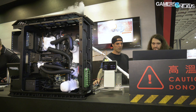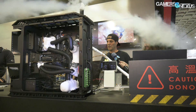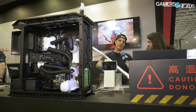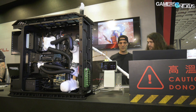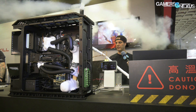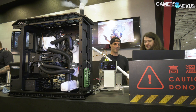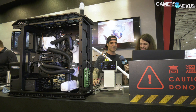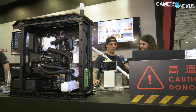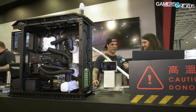It crashed — didn't make it. We passed on the GPU at 7,443. GPU's stable, but the CPU crashed. Right now we're trying to calibrate the controller with the actual reading temperature. This CPU needs about minus 85, real temperature on the evaporator — it was at minus 60, that's not enough, it needs to be colder. Passed — 5.7 stable! So what do we have for score? Should be a nice decent CPU score. 20K. That's what I want to see.